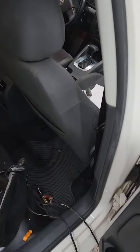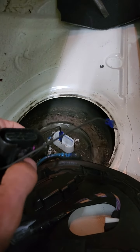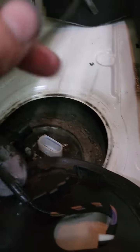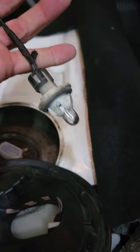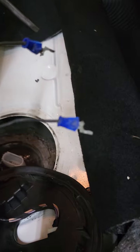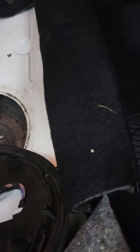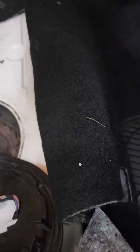I'm not going to tell you how to remove the plug because there are videos on how to do it. I've got a little test light made out of a signal bulb, and I put a couple of adapted pins on it. I'm going to plug it into the two power wires so you can verify that you actually have power back to the fuel pump and don't have a more serious problem.